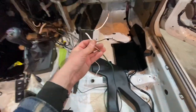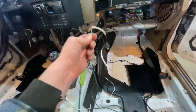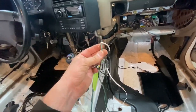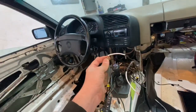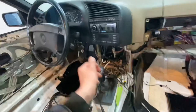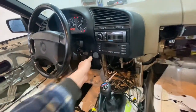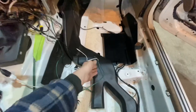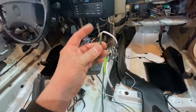This positive from the battery will supply power to all three motors to open and close the roof. But when your car is turned off you don't want the roof buttons to work — you only want them to work when your ignition is on. So we need to make this wire switchable — meaning this green wire will only have power when the car is on. We're going to do that using relays — it's super simple.